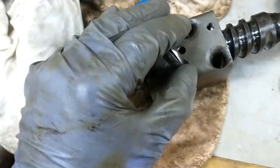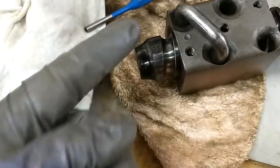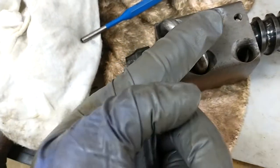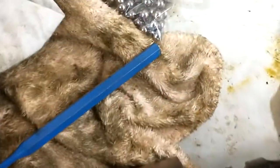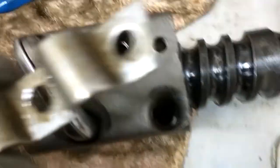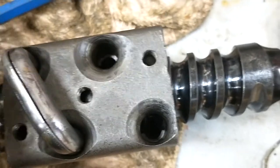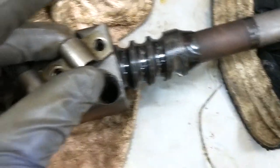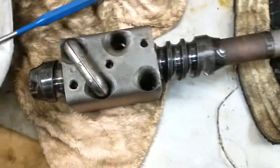You just put them back in like that and the balls flow around as you steer. Same on this side. Then you've got the guide keepers — right here — it just goes back down, screw it down in place, give it a test, maybe pack a little oil in there, and then off you go.